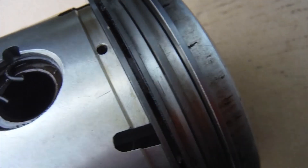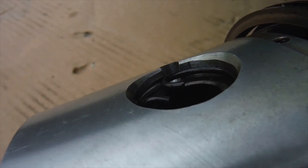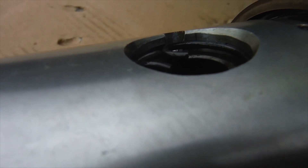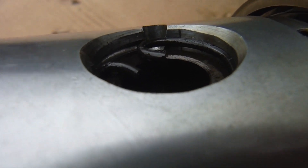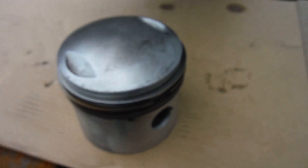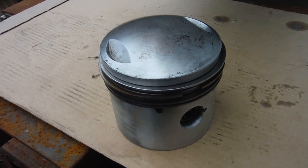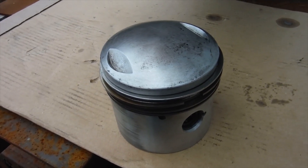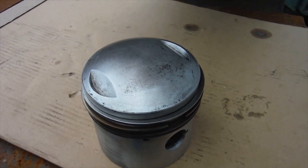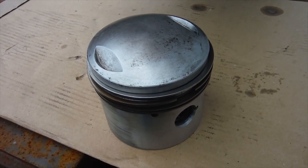There's actually a little bit of movement available side to side on the gudgeon pin, which is a nice floating fit in the piston. It's not up tight against the circlips when everything's in position, which I like. The oil pumps also checked out well — everything's been cleaned and put back together, and I'm happy with the entire bottom end. So I'll put the piston in, put the barrel on, then it'll just be a matter of putting the cylinder head back on and the engine will be ready to go home again — third time lucky, hopefully.